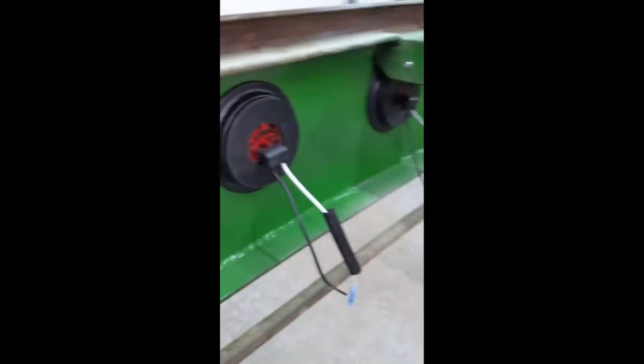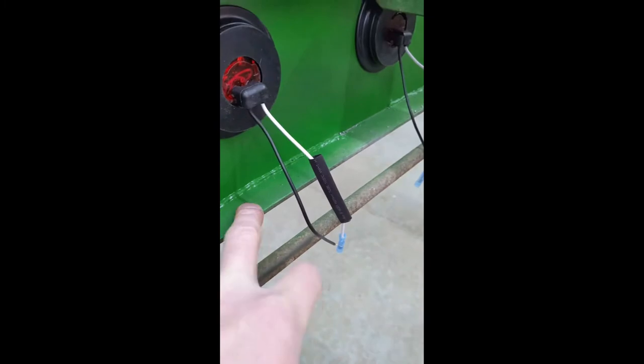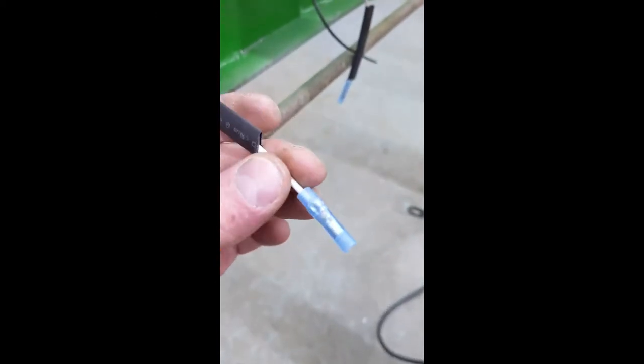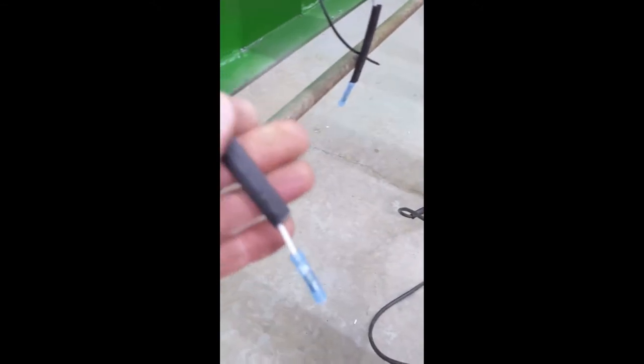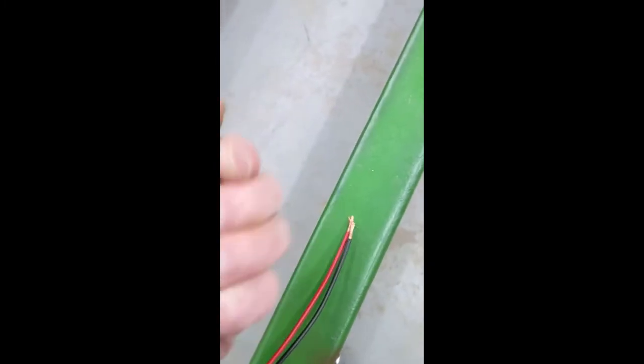I'm having a little trouble finding a decent spot to ground my rear tail lights. I never like putting a ground on a horizontal or flat surface where water can pool and not drain — that causes the connection to rust and corrode much faster and eventually fail. So I decided to extend these wires with butt splices and run them all to the junction box I'm going to mount. I've got these nice butt connectors with a window so you can see if you did it properly, and heat shrink to cover the whole connection.